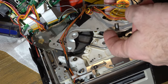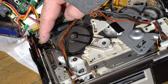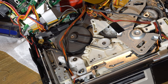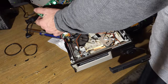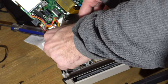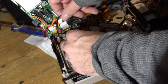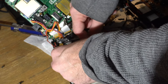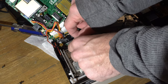I'm recording now. There are our belts — that's the suspect. What's happening is the motor is turning but the pinch roller isn't pressing the tape properly. The question is whether I have a belt that'll fit. I've got my bag of cheap Amazon flat belts. Let me remove the old belt and set it aside. This one is just floppy — the original is deteriorated. We're not going to spend a lot of money on this thing since video quality won't be HD anyway, but this replacement seems like it has a bit better grip. It gives that found-footage feel.